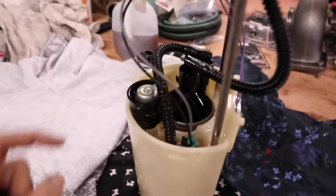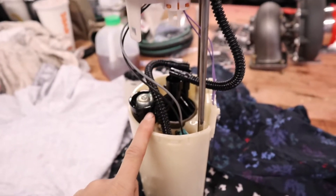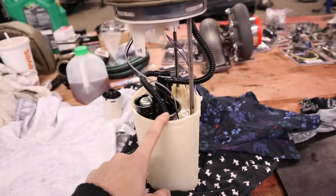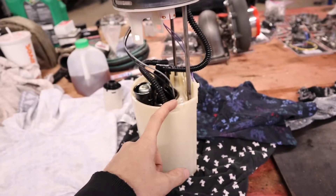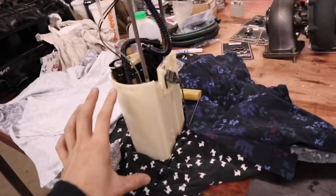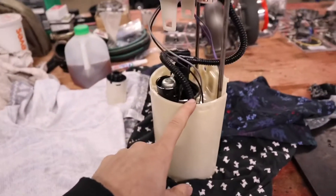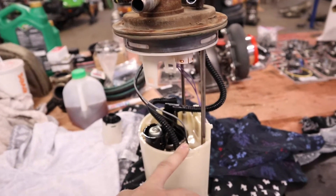There is the fuel hat out of this thing. What I'm gonna try to do is remove all the factory junk and basically replace the stock pump with the Walbro. I have to do some hacking and fitting, but I want to keep the bucket so that I don't get fuel slosh, because I did that on my very first build and actually blew up a motor by starving the pump. These pickups are closer to the front of the tank, so when you're at quarter tank and you pin it, you basically starve the fuel system — it gets air, you get detonation, and things go boom. So I'm gonna try to keep the basket this time. Last time I chopped it all up and ended up with the pumps hanging from nothing. We're trying to keep the basket and run one Walbro 450 in this.